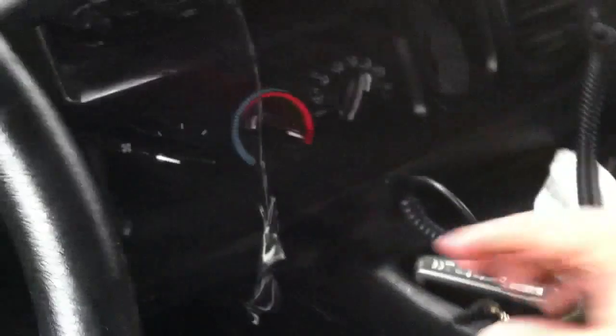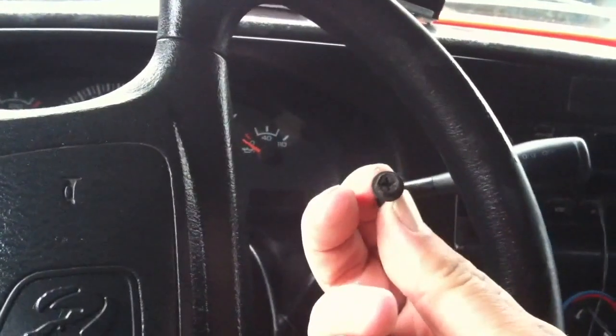The first thing to do is use a common screw gun to remove the screws. You can use either a PH2 tip or a quarter-inch tip to remove the screws holding the under-plate on the dash. You may be tempted to go further but it's really not that necessary. Basically you just remove the under-plate — remove the screws, but realize a lot of it is just pressed in with little spring tabs, so you rustle that out and pop it out.